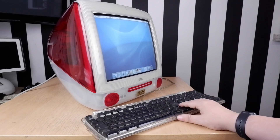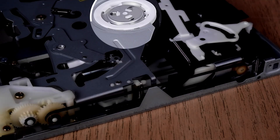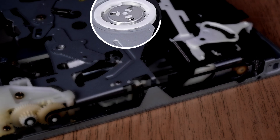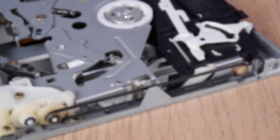So, guess what I've got to do? It turns out my problem was me. I had not noticed that this little disc here had fallen out and I'd put it in the wrong place when I reassembled the drive, which effectively caused it to get jammed. I screwed up. I had to review my footage to find out where this piece went. Fortunately, I had this image which was really useful, and when I put it back together, it worked. The drive was great. I was super happy and was going to move on to the keyboard.